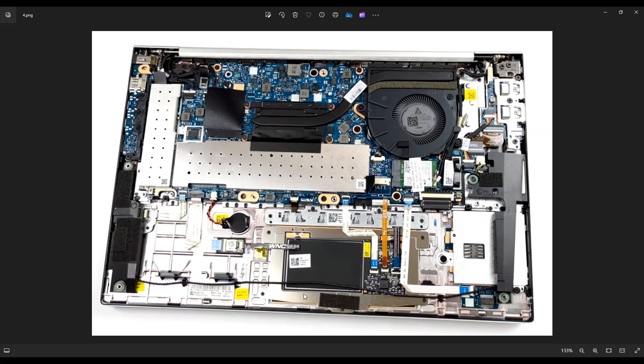Other than that, you have a touchpad down here with all the various ribbon cables that come up from there. You have your USB board here and your USB board here. These types of ribbon cable connectors — you see ribbon cables all over the place — there's a large probability of damaging these if you're too rough on them. These are very fragile, and if you break them, finding a replacement is very hard, which would mean that your ribbon cables won't ever connect fully or securely. So you definitely don't want to break those. At the end of this video, I'm going to play a quick tutorial on how to manipulate these ribbon cable plugs.